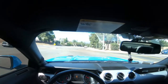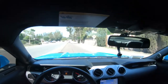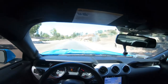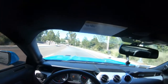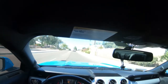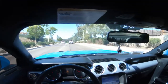So what the issue is, I don't know. Is there even an issue? I looked at some pictures of this setup on other Mustangs — one looks like it has sort of the same stance as mine, and another looks like it has an even stance all the way around. I also read on the Mustang 6G forum about a guy who put the same setup on and used quarter-inch spacers in the rear. But from the measurements we took, it looks like it's three-quarters of an inch off. I haven't had time to get those measurements back to Brian yet, but I'm going to send him the measurements along with pictures, and we'll go from there.